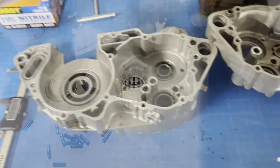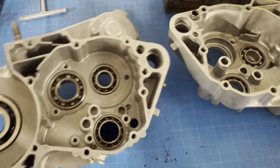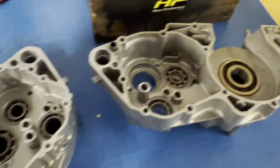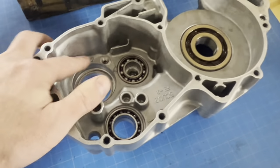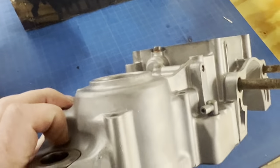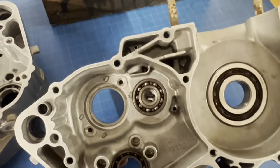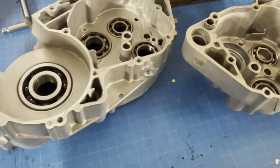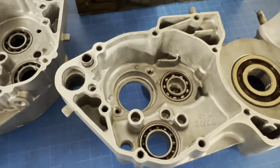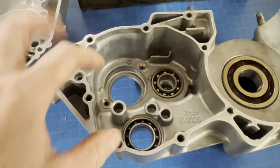We're pressing together Jared Lesher's supercross and arena cross YZ250. We vapor blasted everything, got it all cleaned up, ready to reassemble with new bearings. We need to do this bearing here — he broke this bearing on his other engine at the Indianapolis supercross round. We did some measuring to see what we can upgrade. Unfortunately, Yamaha has a custom spec bearing unique to Yamaha you can't buy from a bearing house, so we're going to fit a KTM output shaft bearing from a 250F — it's a roller bearing, not a ball bearing, with higher load carrying capacity.